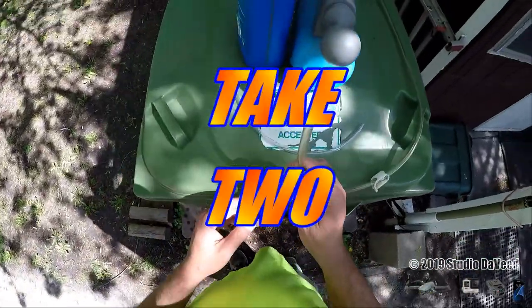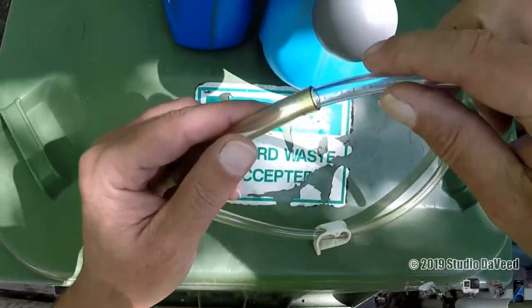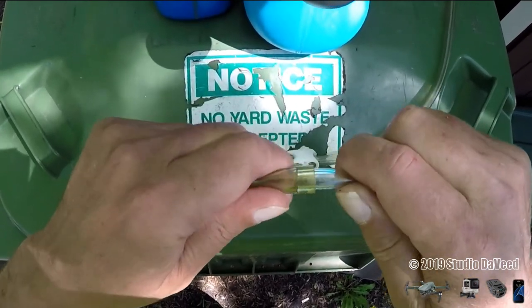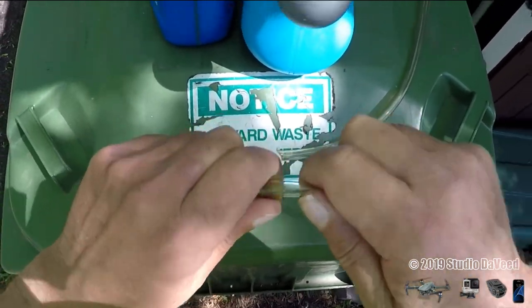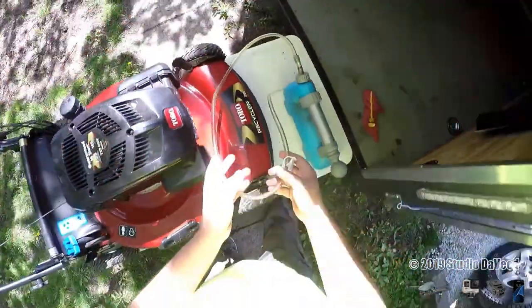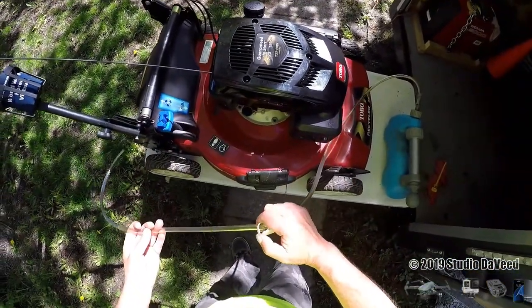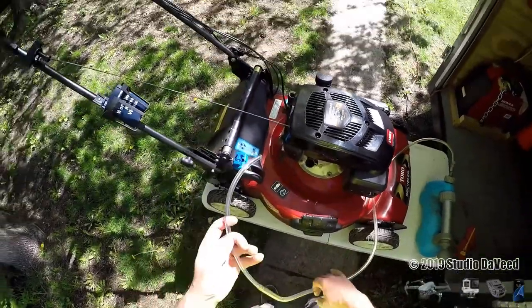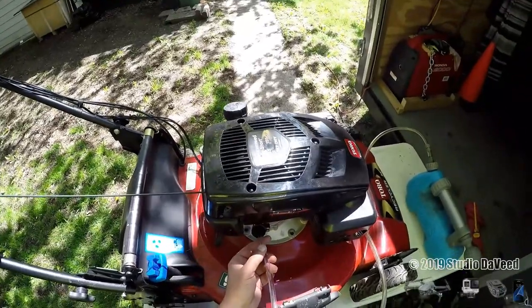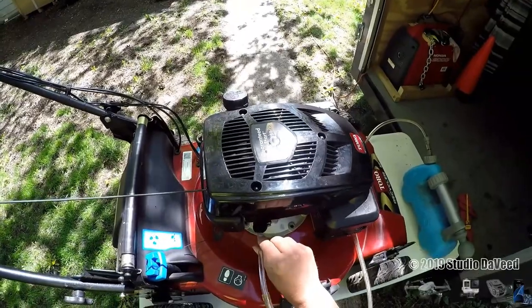Let's try this again. This did not fit in the fill tube — the oil fill tube. Went to the parts store, got some more tube — this just fits in there pretty tight. This should get down into the dipstick tube and then I'm sucking out oil. So just a repeat: you pinch off the hose with this clip, insert the tube down into the fill tube. There we go — kind of wiggle it around.